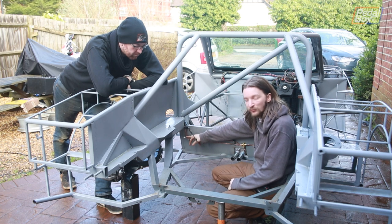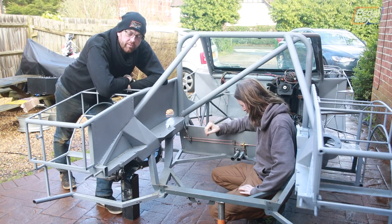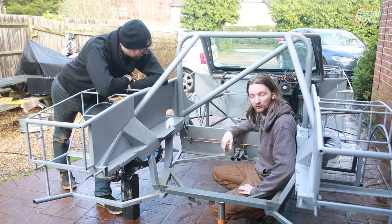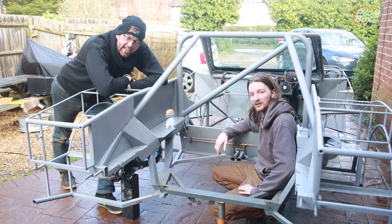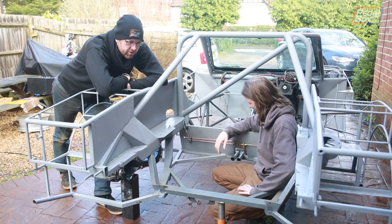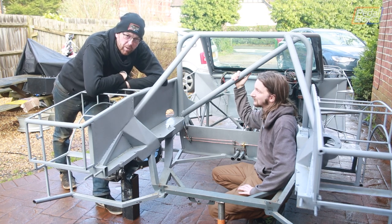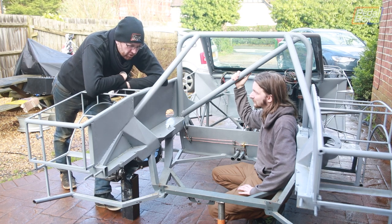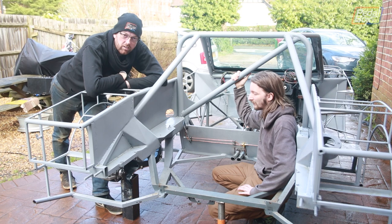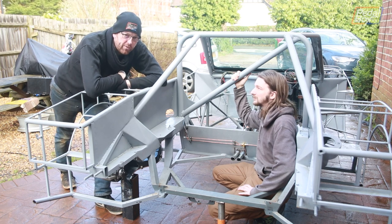All in all great success — we've got brake lines all the way back to the corners of the car ready to hook up onto the flexes for the trailing arms on both sides, and we've also got the clutch line ready to go into the transmission. The only thing we've still got to sort out is replacing the cylinder on the back of the handbrake because it has a 7/16 fitting that we can't hook onto, but that's a nice easy one to fix. It's also really good to have got lots of little jobs sorted on the back of the car so we can start remounting the rear lights. Before we get the engine back in, we're going to flip the whole car over and finish up a bunch of the underside — put some brackets in and finish up a lot of the welds whilst it's all stripped down so we don't have to do a complete unbuild-rebuild again.